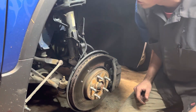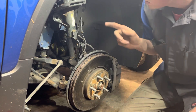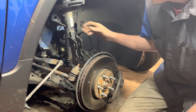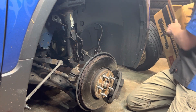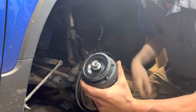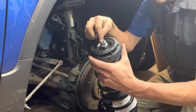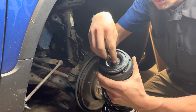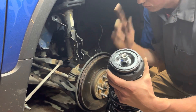This strut is actually one of the nicer ones — up above we have just one nut to take off and that's it. The strut is literally being held in by that nut up top. I'm going to pop the hood in the next segment and get this nut off. We may have to hold the Torx or allen while we get it freed up, and I'll bring you up to where we're underneath the hood.